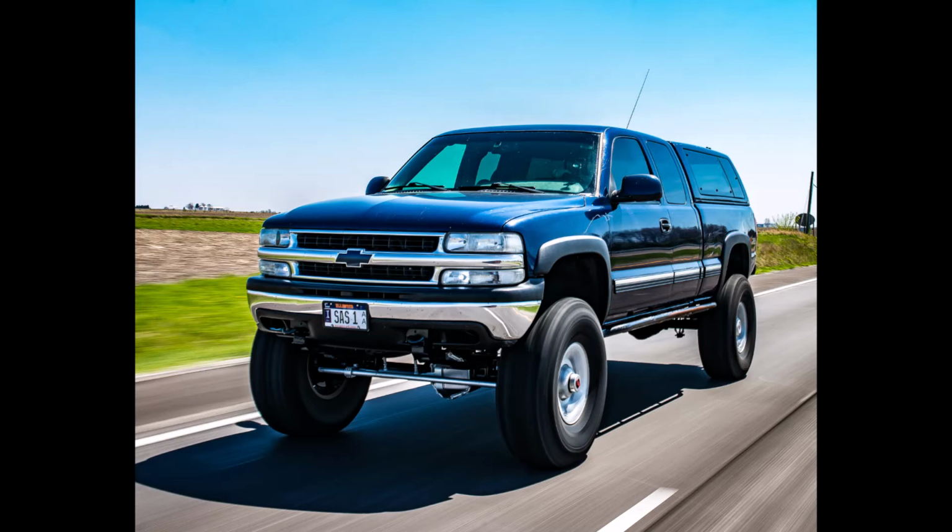Yeah. Then it was a new pan and everything. You had to do completely different everything for that. It would have been nice, though, because I think the pan had better clearance underneath, and so he could have lowered it. Scavenging pans are really short. Yeah, especially on a diesel, they've got those huge pans. LSs are nice because you can just steal one, in air quotes, off of an LSA or a Corvette or whatever. Oh, really? That's cool. The LS9s, I think, came with them. Wow. Not LSAs. That's awesome.